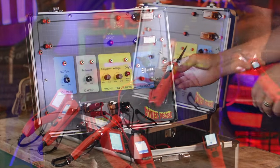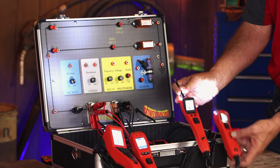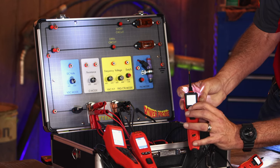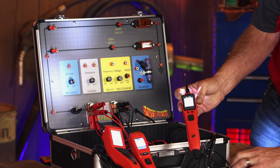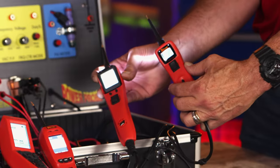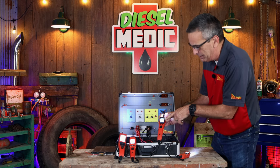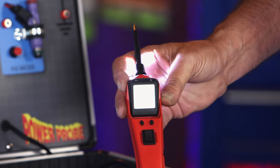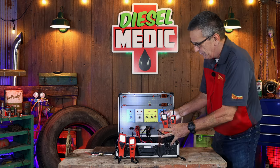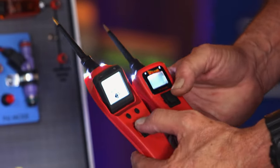The PowerProbe 3 and the 3EZ are functionally identical — they do the same functions and the same tests. We just updated the 3 with a nicer new display that's easier to read and added a menu to get to the different test modes. All those test modes were actually in the PowerProbe 3, but a lot of people weren't aware because they never cracked open the owner's manual. There are different tests you can do such as min capture, max capture, peak-to-peak voltage. It's not a true AC meter because it doesn't read anything negative, but it will read pulses like 5-volt pulses — things we deal with in the automotive world like wheel sensors. These two are the same tool and their primary function is the DC voltmeter and applying power and ground.